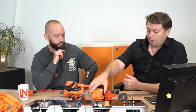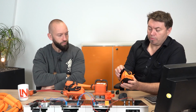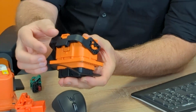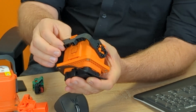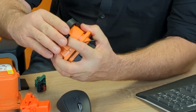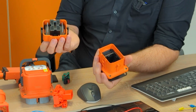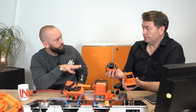Yeah. So, for example, with the different connectors that we see here, it's partly open right now, but there's a multi-stage connection to this. So you have to pull this section up first. If you try and pull it up, that's the first lock. Pull it up to here, and that's also locked again. We have to sort of push down on the connection underneath, get it up, and then we can undo it here. But this task you always have to do with your safety gloves, right?